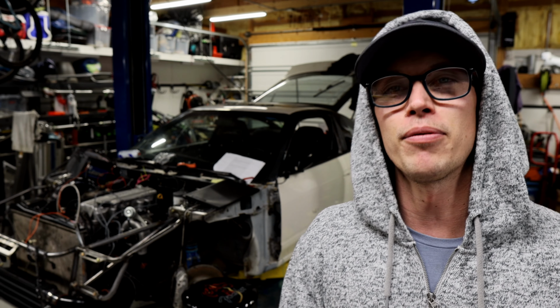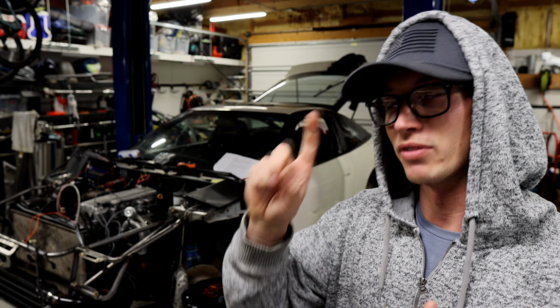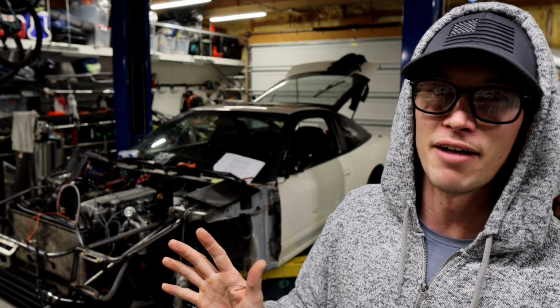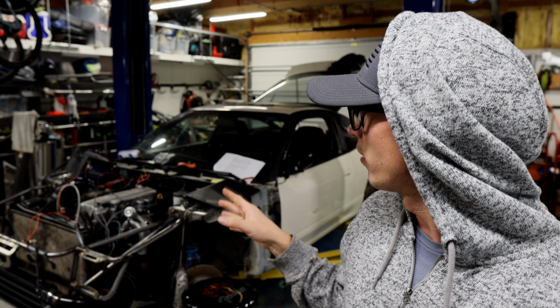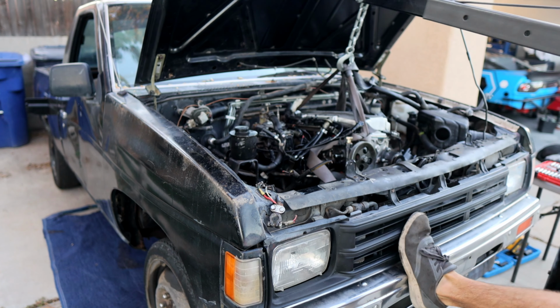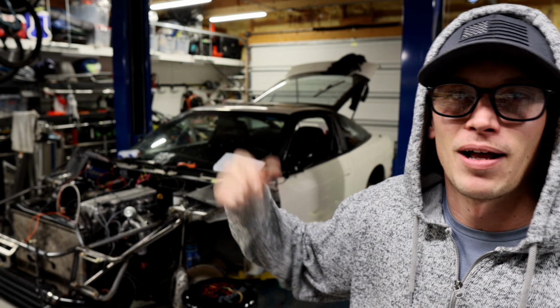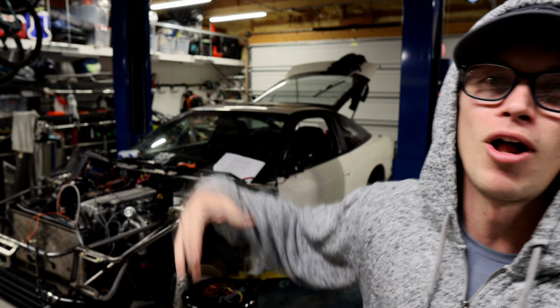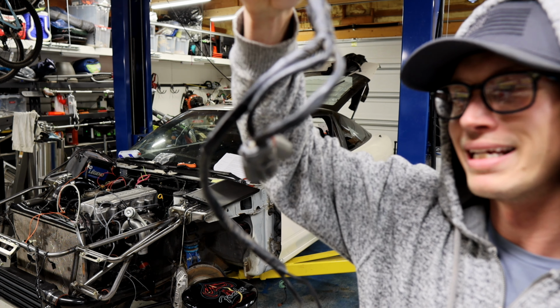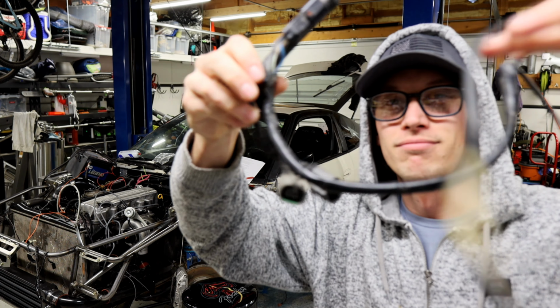So we've confirmed through the ECU that we have ignition, we've got injector pulse, we've got timing, we've got all the good stuff on my end, but there is nothing happening with the coil. This motor is actually out of a Nissan D21, and it's in here now, okay? I'll link some videos in the description to all of this, because it's a lot. And if you don't know what I'm talking about, this is the wiring for a D21 coil and condenser. It's $2 at You Pull It.